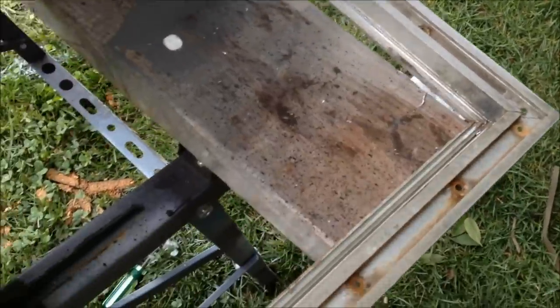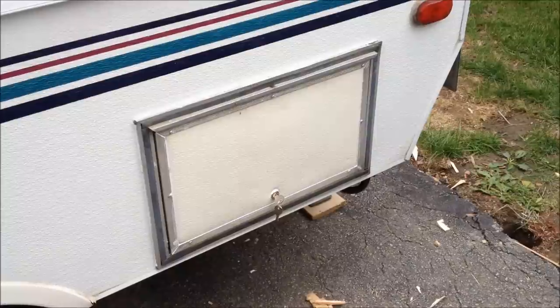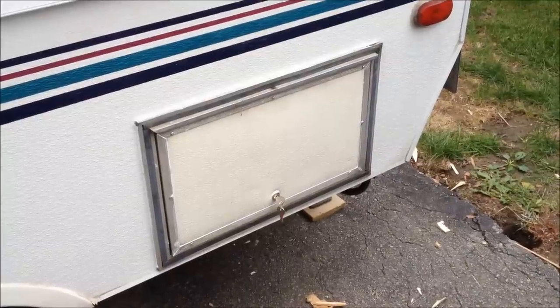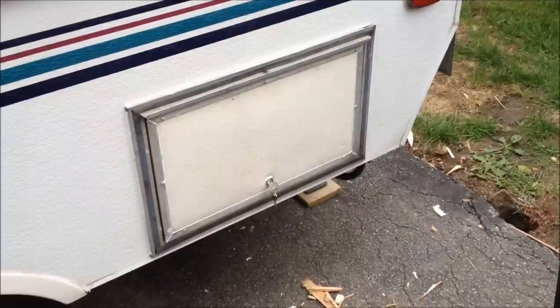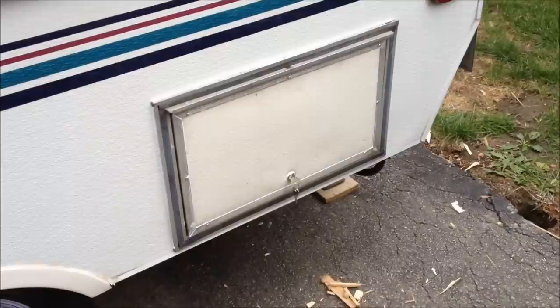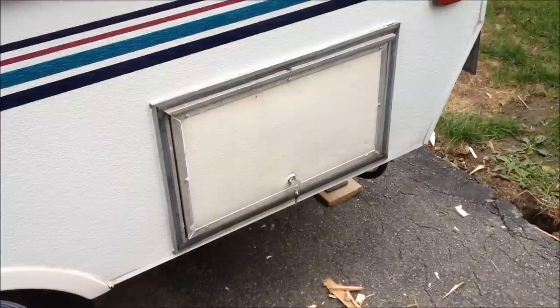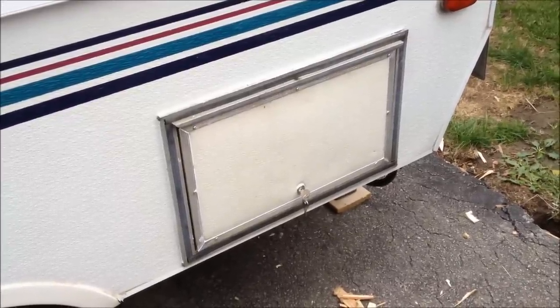I still have to put some weather stripping in the channel to give it a nice seal. And I also bought some white paint, so I'm going to be going over it with some white paint to give it a nice fresh look. It is a very close match to the vinyl on the trailer already, but let's freshen it up and make it look nice. Here we have the door all installed — all secured in place. What I did is put a very thick bead of silicone around the flange of the door, so that way when it's screwed into the body and framing of the trailer, it's squeezed out, making a nice seal in there — stopping any water or anything else from getting in. Nice and sealed.